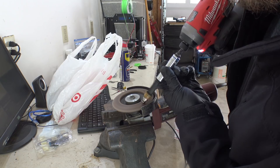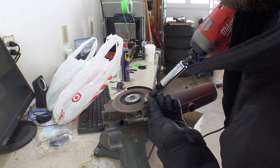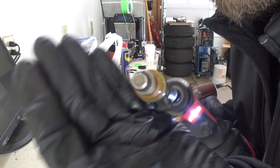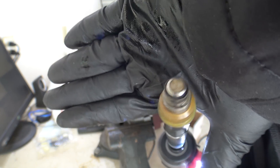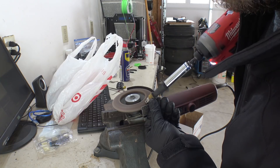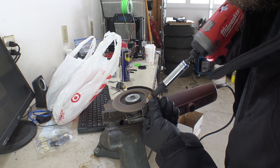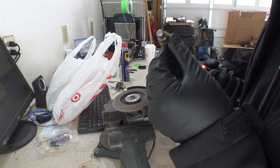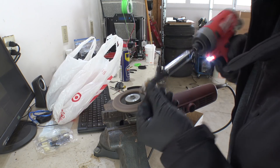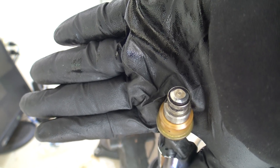As I progressed and learned how to do this, holding down near the tip is definitely the best way. I also moved the camera and zoomed in so you can get a better view. You can see it's starting to taper the edge around the pinch weld, whatever you want to call it. I'm spinning that guy, making sure I'm not going too far. I have the audio turned off because the grinder is so loud and I'm running my heater. The tip's gone and there's a nice tapered edge.